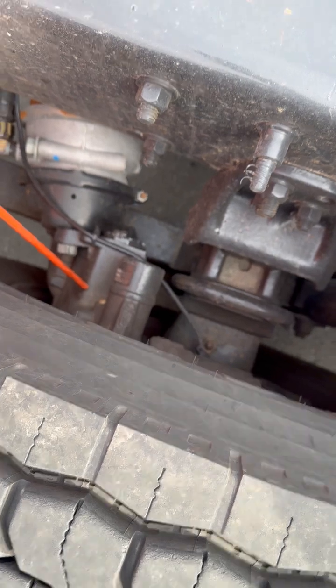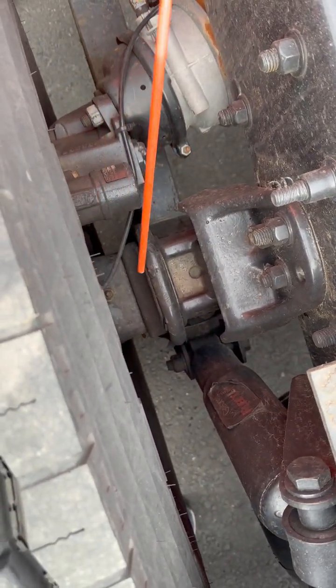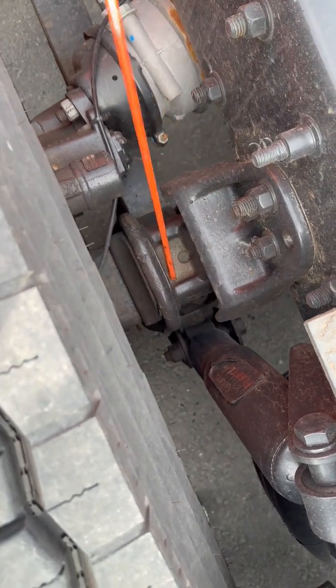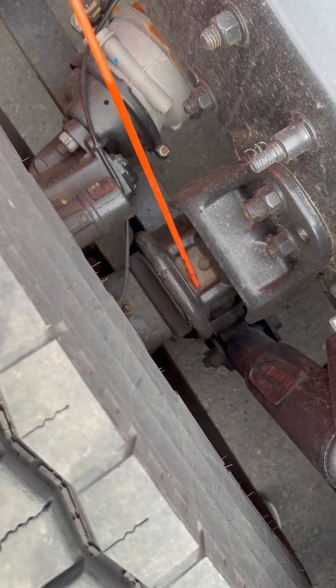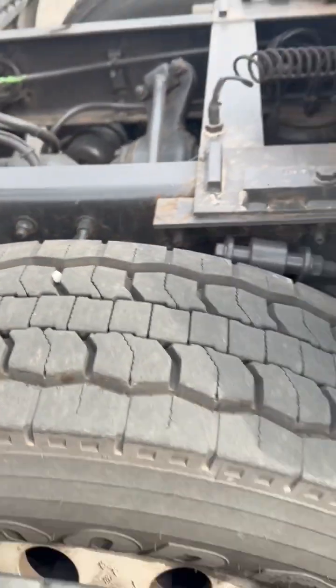My brake shoes, brake pads, brake linings, properly mounted, not cracked, broken, or damaged. Has all of its nuts and bolts. And has no less than 1/4 inch of material. It's free of dirt, oil, and grease. My brake drum, properly mounted, not cracked, broken, or damaged. It's also free of dirt, oil, and grease. Work my way back out.